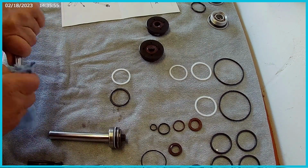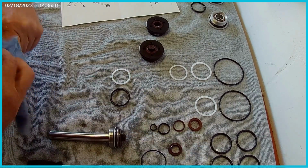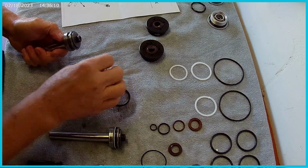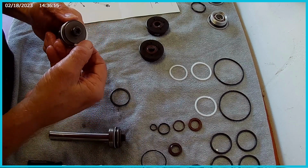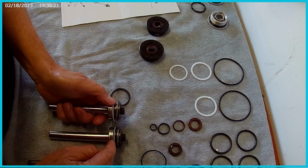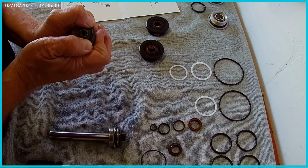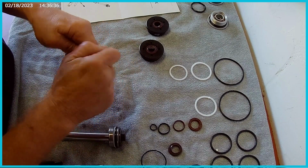Now, could be that it's leaking because I should have used those and I used these instead. And so if this leaks again, there's always one last shot, right? And that is to go and try this next set over here that's a little bit bigger, because now I don't have the originals, but I think I matched them up pretty nicely when I did it the first time. So you can see that the order goes on, the little Teflon or plastic piece goes on this side, then this new seal goes on like that. Alright, so that goes on pretty easily.